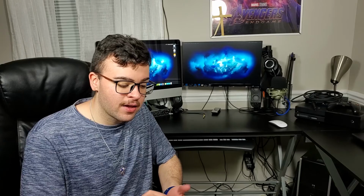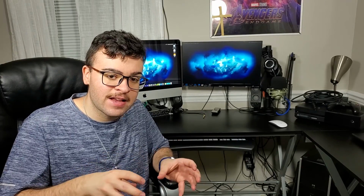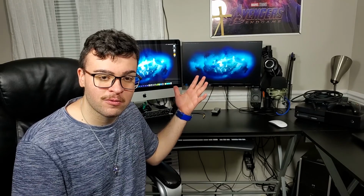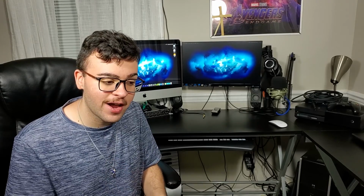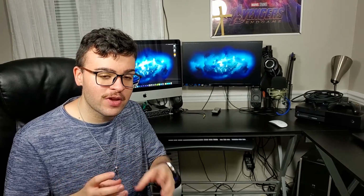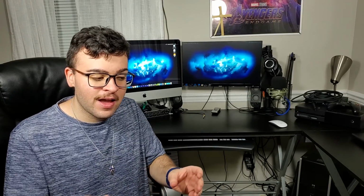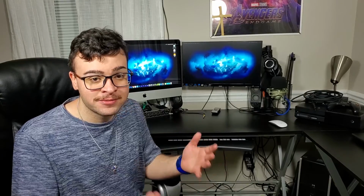And what I did was I fixed it with tweezers, and I slowly bent it back to where it originally is, and I placed that connector last. Out of the 4 there, I placed that connector last. Made sure it sat in well and placed everything back together, and this was the result. I want to thank my dad because he was the one that told me that everything was going to be fine. You just have to straighten the connector up and just do it last, so that you're not moving it around, and you should just place it in. And this was his idea to fix that connector, so thanks, Dad.